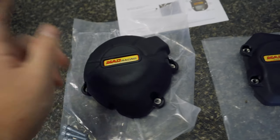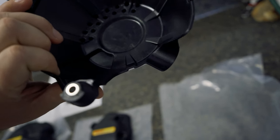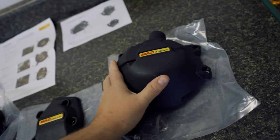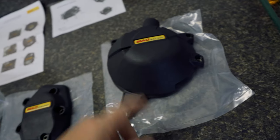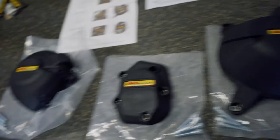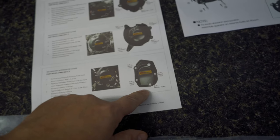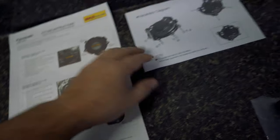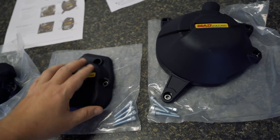I'm not sure about the Mad Racing in yellow — I might just paint these black. I've popped them out; they're just little stickers. They look identical to the ones on RevZilla. Quality-wise, I like them. For $110 — I'll put a link in the description — it's half the price. If it gives me protection for half the price, I'd dig it. It comes with instructions and torque specs: 11 newton meters for each bolt. It comes with everything we need, other than some Loctite. So we're going to go ahead and install these and see how they look.